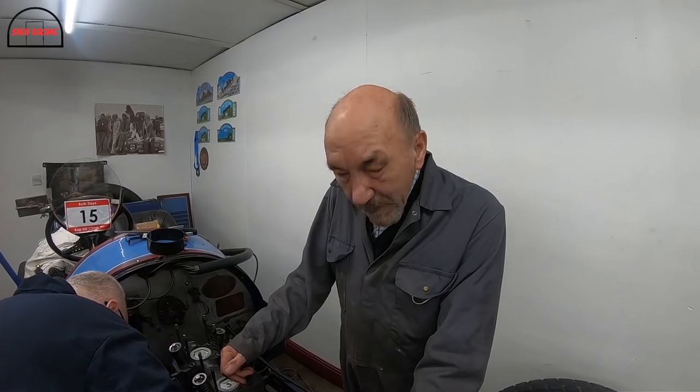And I understand what you're saying, and it is a standard procedure. But in this particular case, with these early engines with bent wire crankshafts, I think having a heavy flywheel is a very good protection in avoiding sudden shocks to the crankshaft and breaking it. So that's why we didn't have a very light flywheel.